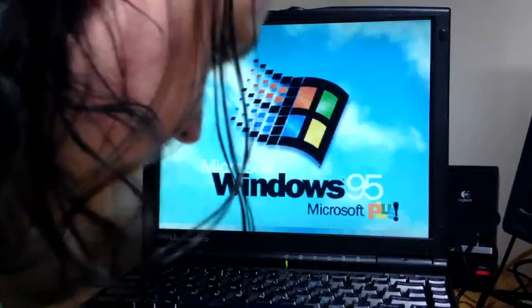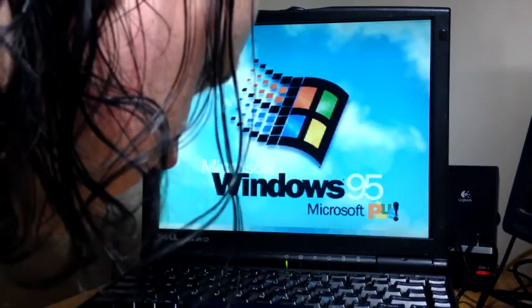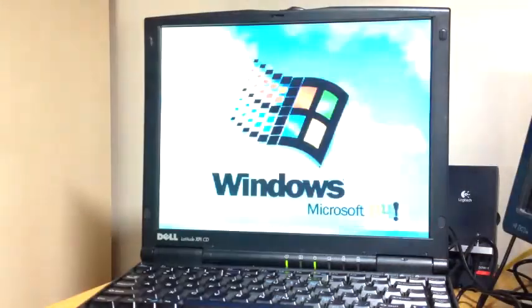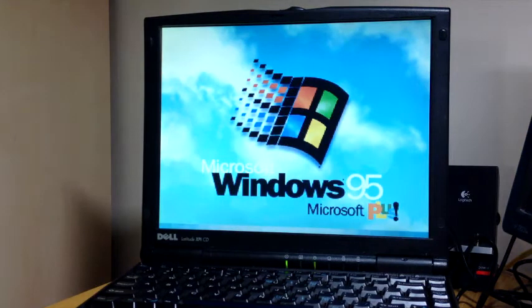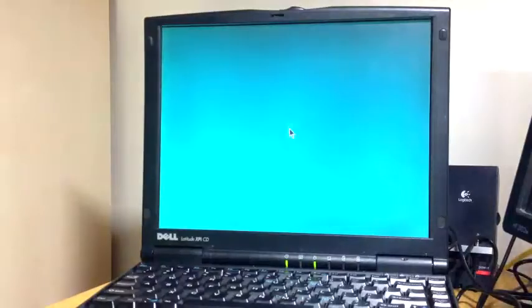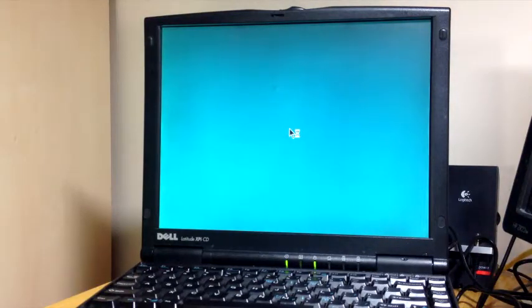And as you can see, I've installed Microsoft Plus. I've also tested QEMM with Windows 95 as well, just to see how it goes. And to be honest, I freed up all of 44k of RAM. Hardly worth it, in my opinion. It's more useful if you have a DOS or Windows 3.x workstation. I guess the only thing that I would want a memory manager to do in Windows 95 would be to manage a program in its separate memory space, like Windows NT does, but then that would probably interfere with some of the compatibilities of Windows 95.